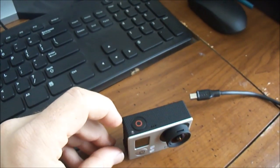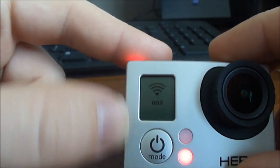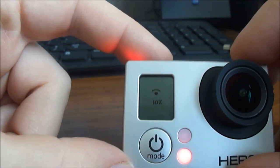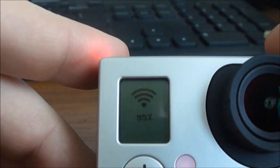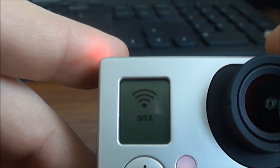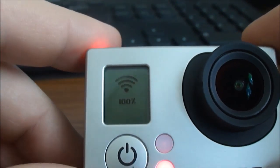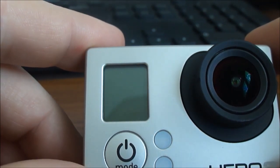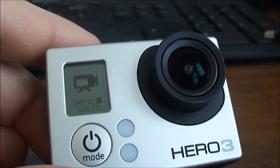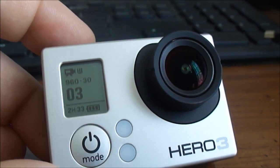To test that it worked, I just set the camera on the desk, hit record, and filled up a whole 16 gig card — let it run for a couple of hours and it never turned off, so I knew it worked. You'll start to see a progress indicator that looks a bit like a Wi-Fi symbol showing 10%, and it says 'Updating' — that's a good sign. Eventually it gets to 95% and then 100%. Just let it ride, don't do anything. It finally shuts off, and if it just shuts off, that means it worked. Turn it back on and you're ready to go. I hope this helps.